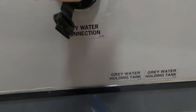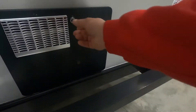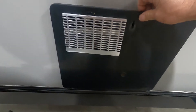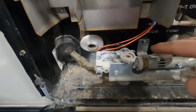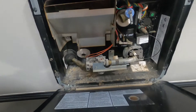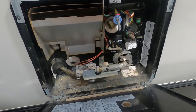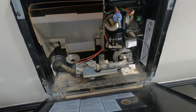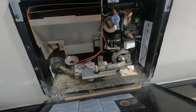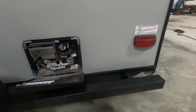Hook that up to the city water connection, hook up your hose, but don't turn your hose on yet. Come to the rear of the unit to your hot water heater — all we're doing at this point is returning the drain plug. Put that back in there nice and snug, then you can go ahead and turn on your hose. After the hose has been on for a little while, go to the front and turn on your hot water tap — as far away from the heater as you can. Once water is coming out of there, you know your hot water heater is full and you can turn it on from indoors.